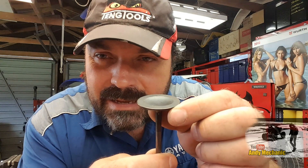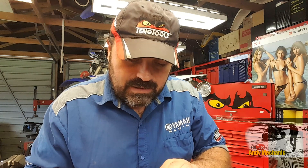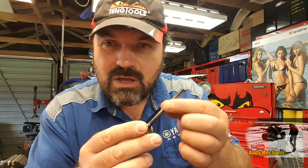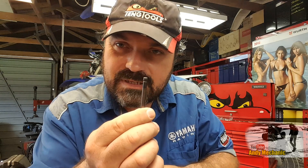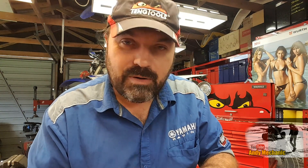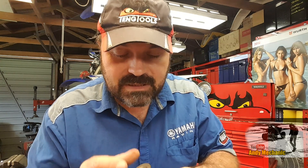There's a bit of a concave area on the valve and I want to get rid of that, so I'll turn it down in the lathe — assuming my bit's hard enough — and make it a dead flat surface. That will give us nice clean metal with no impurities and no grease. I'll give the rest of the valve a clean with brake cleaner to make sure there's no cross-contamination onto that surface, because there's obviously oil in the metal around the stem. So I'll do all four in the lathe, clean the fronts off, and then I'll weld a big nut onto the end of each stem. That will obviously test my welding as well, but I'm pretty sure my welding is going to be stronger than the epoxy glue. Right, let's crack on.